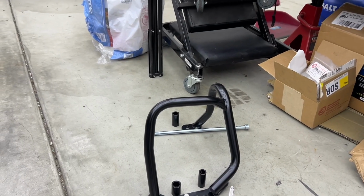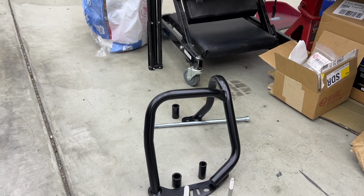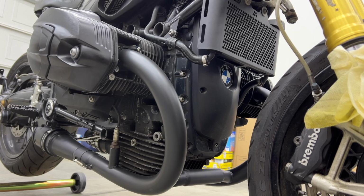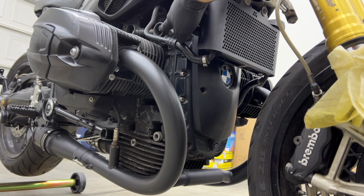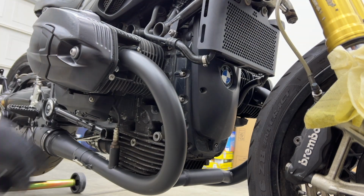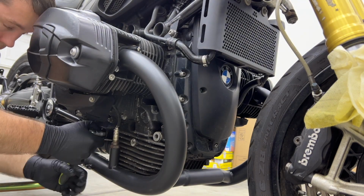It does make somewhat sense the way they say it, but also it doesn't. Because they want you to take it on first, but then they can't reach the other bolts. So basically they have to loosen it up first and then just take it on. I start by removing the bolts from the frame that I have to replace. The one up here, it's 18 hex here, T55 other side, and of course the T55 here, left and right.